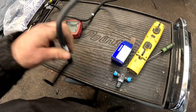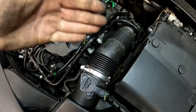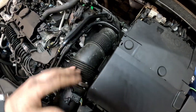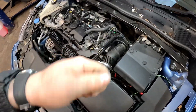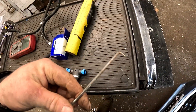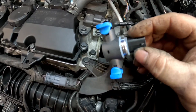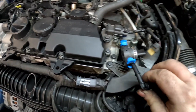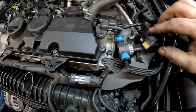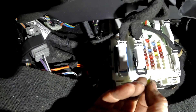When you order the new sensor, they may ask if you want the fuel pipe to go with it — I've opted yes. We're going to be putting the fuel pipe on, which goes just down the side of the air box, the air intake. You don't really need to take it off. It goes down the back there with two little white clips. The actual sensor itself — I don't think it matters which way you put it on, but we're going to put it on with the little tab at the top. It should just click on like that, then push the tabs down and plug it in.